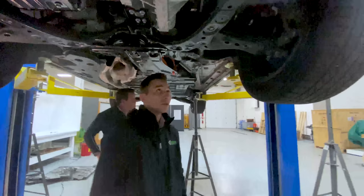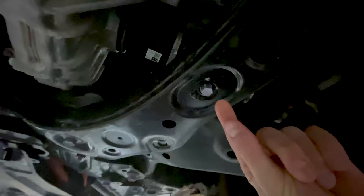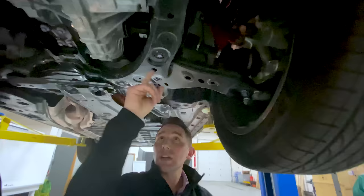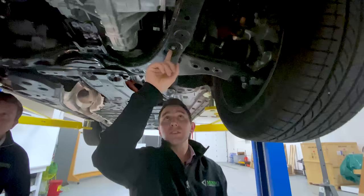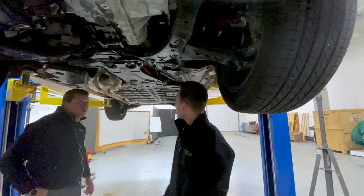Toyota's never one to brush over the details. One thing we always like to see is dedicated paint-cutting threads. These points are where the lower control arm mounts down through the cradle — because the bolt is going through a painted hole there's a high propensity for an enclosed cylinder like that to collect extra paint residue. This bolt head design ensures that as you run those fasteners down you have a method of clearing those threads before engaging the threads that will ultimately hold the control arm in place.